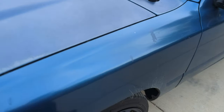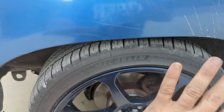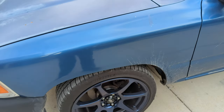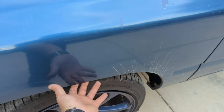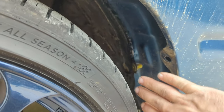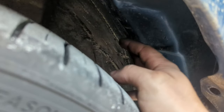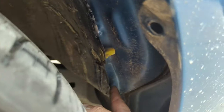Getting the four-wheel-drive fenders would give me a little bit of poke on the front to match the flare in the rear, and also give me just a slight bit more room on the inside. Currently, when I get two people inside it rubs. The inner side of the fender here is rolled over so it's not going to rip or slice the tire, but it does hit a little. I had to take the inner fender liners out because they were damaged from the wreck and were rubbing and making noise. There's also a pinch weld here that's supposed to face straight down — I hammered that flat, and I knocked back the firewall slightly right here.